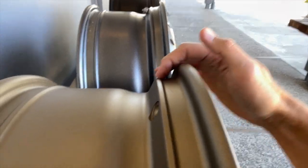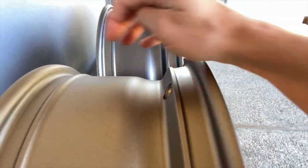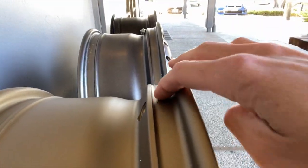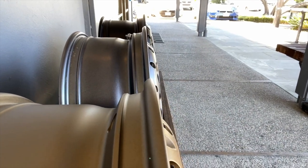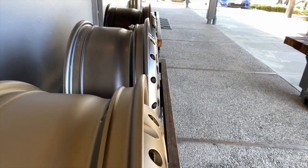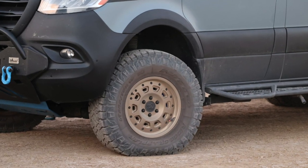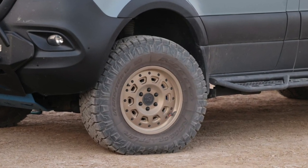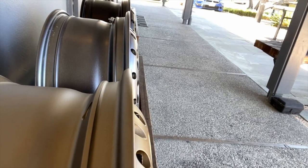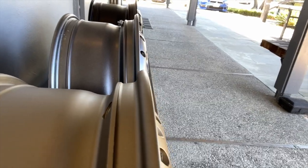I don't know if you can see this little ridge right here — this little ridge is really important for keeping the tire on the bead. When you are off-roading, you obviously want to take your tire pressures down, and that is an opportunity for the tire to pop off the bead. But just having this little lip keeps it on there. Because bead locks are not legal on the street, this allows you to get the advantages of a bead lock. It's on the inside and the outside — most bead locks are only on the outside — so it gives you that bead lock-style advantage without something that's not legal for road use.